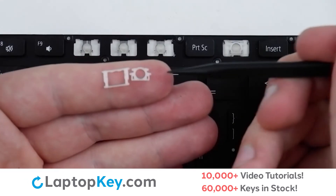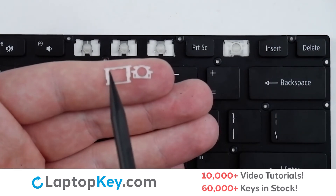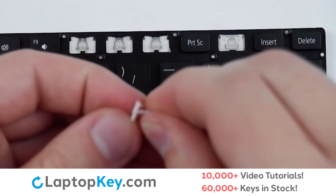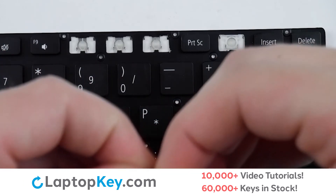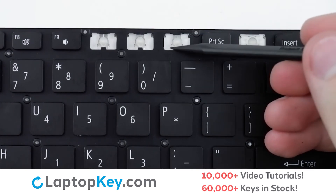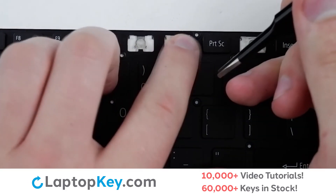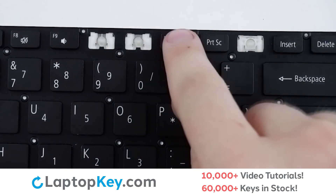To assemble your clips, we'll begin with the top clip which has two small holes at the bottom, and the slightly jagged curvy edge will be on the top side of the bottom clip. Connect the two halves together, putting the top half in slightly at an angle in the middle, pushing down. Then, using the metal hooks, we will lay the clip down bottom first, ensuring it hooks on, pressing at the top. Put the keycap back on top with a firm press, and we're functional.